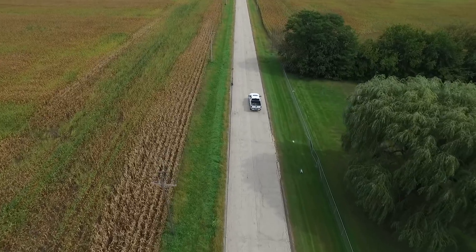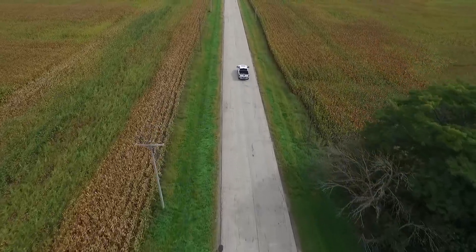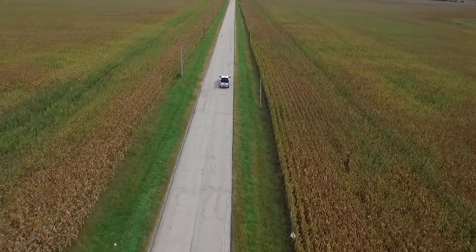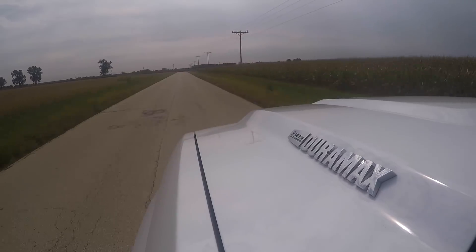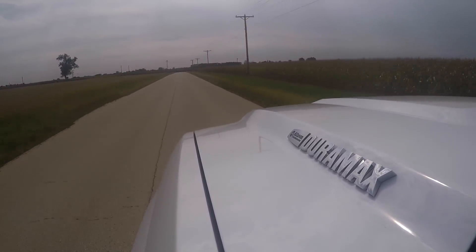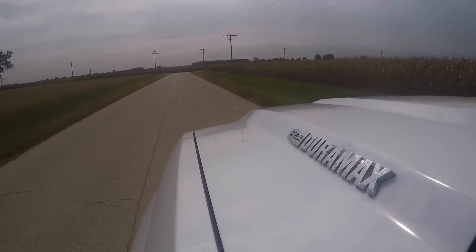What we really need to do now is drive the truck. That takes time in the seat, time with the trailer, time on the dyno — just racking miles up and seeing how the emission system performs, seeing how the truck tolerates the extra power, seeing what the limitations of the turbocharger and fuel system are, and how the truck's going to reject heat under heavy load. We're not there yet with the L5P. We'll get there. It'll take time, and that's what the next few weeks, the next few months, the next thousands of miles are going to be about.